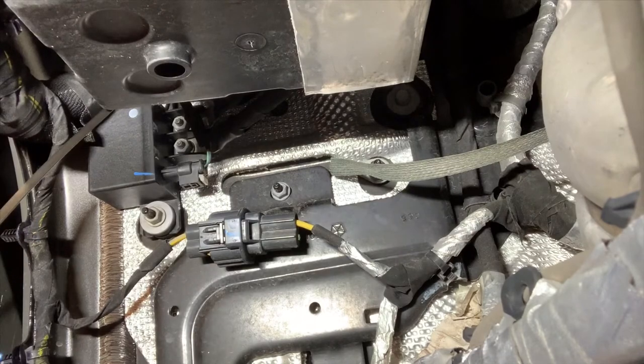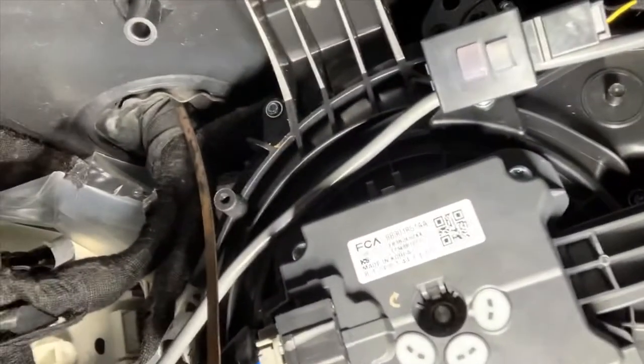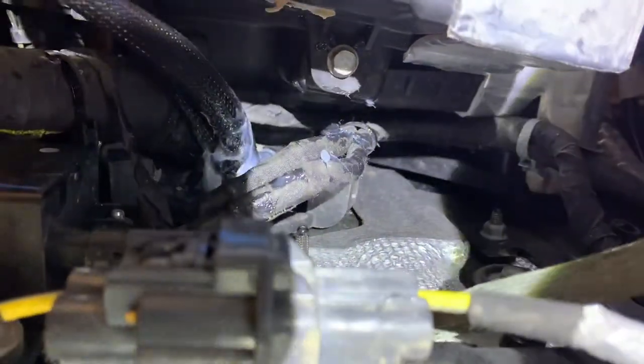And there's the fish line. Just so you know, that rubber boot up there — the rubber boot that the main bundle goes up into — is where I was forced to push it through. It goes up through the passenger side up into that main section. Since you poke it on one side, it's a double boot. With that, let's finish this thing up. I have to seal it. I siliconed the boot to make sure no water came back through — it's not the cleanest job, but it's not easy to get to. Just make sure you seal it back up.